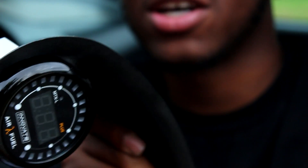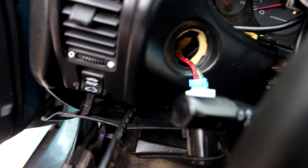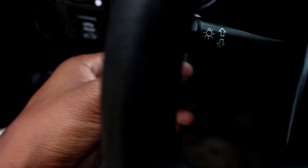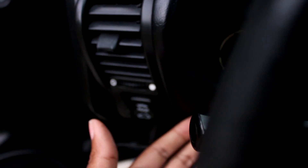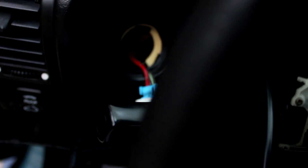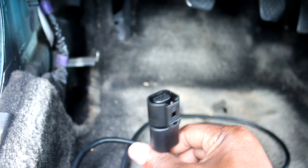I had to run this wire which goes to the O2 sensor through a little hole — I popped it out and ran it through the firewall because it needs to link up to the O2 sensor wire down in the engine bay. Then I've also got to wire in the ground and power to get power to the gauge. For the ground I'm thinking about just wiring into my cruise control since it's close and has power when clicked, rather than running all the way to the radio.